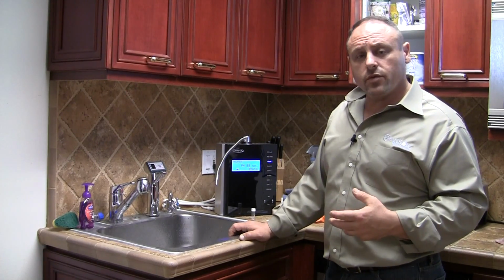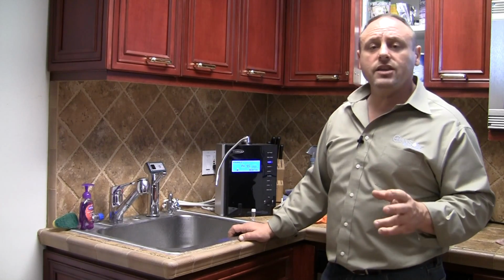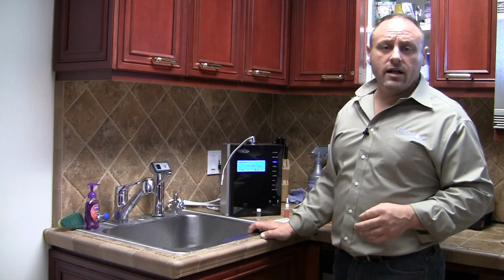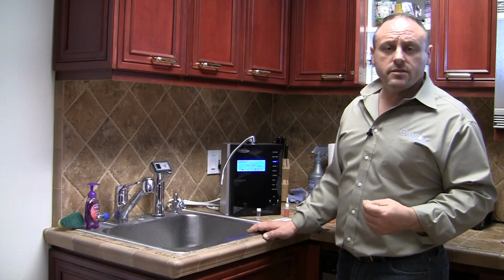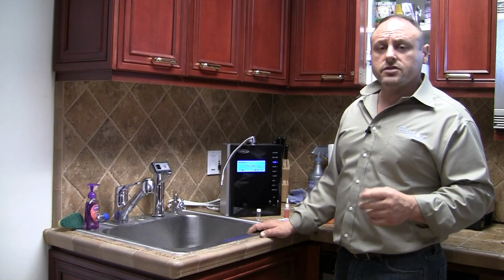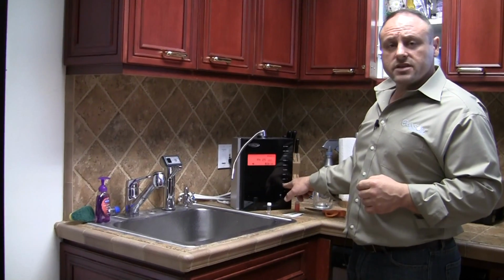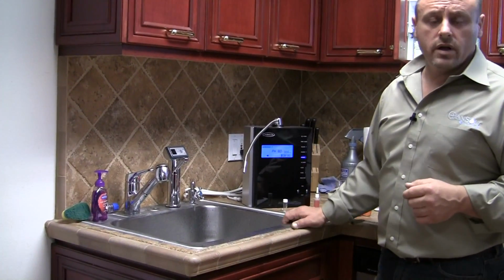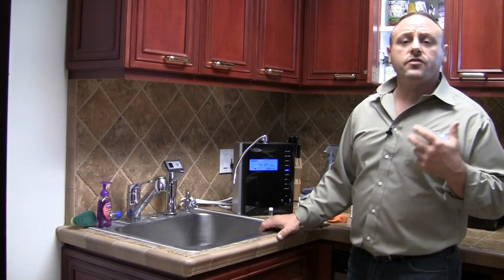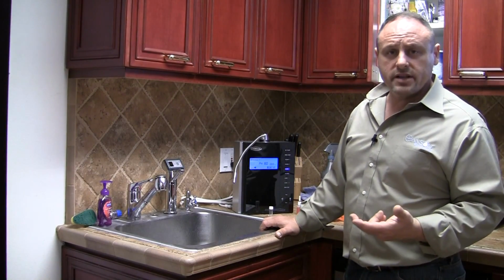They're very nutritious for you, and you can consume them that way. Do not use the salt for alkaline 2, alkaline 3, or strong alkaline. There's too much power being sent to the plates for those settings, and it's not good for the machine. So there's only 2 settings I'm recommending you use salt on: strong acid or alkaline 1. Strong acid is for sanitizing, external use only. Alkaline 1 is for drinking water if you're in low mineral or soft water conditions.